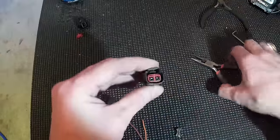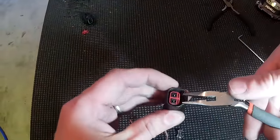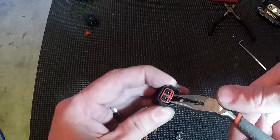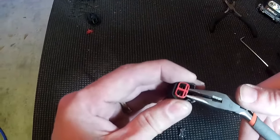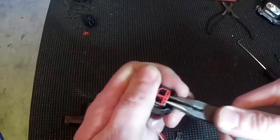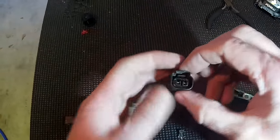Taking my junkyard part, all I want to do is come up here. The first way I like to try this is just putting my tips right there and using this piece as leverage. Very gently — you don't want to do it too hard or too quick, because you'll snap that plastic. Very gently just push up. I'll see this one's caught a little bit, so I'll just give it a little bit of force, not much. And then it finally released. So you want to keep this piece, because that locks those tabs into place.